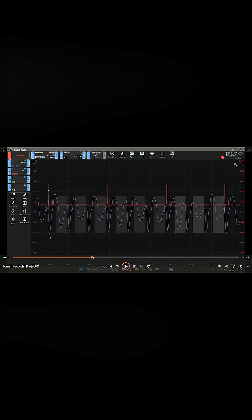Hey, I'm just going back through the footage on this Ford truck. I can see a clear indication on the PicoScope that number two is flowing more than the other cylinders on that bank, so I feel a lot more confident now. Even though the balance test showed less flow — but that's not with vacuum. Vacuum has an effect on fuel injectors. That's the whole reason they put vacuum-assist regulators on there — vacuum on the tip of those injectors affects flow rates. So we're looking at it in a more dynamic way with the engine running, and I'm absolutely seeing more flow from that number two injector.